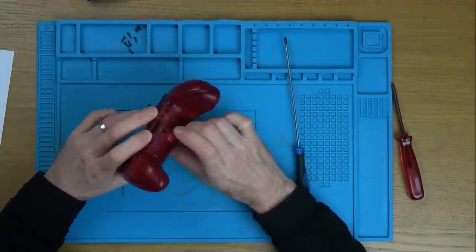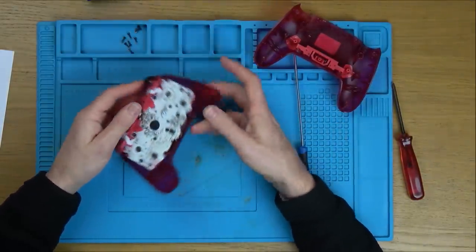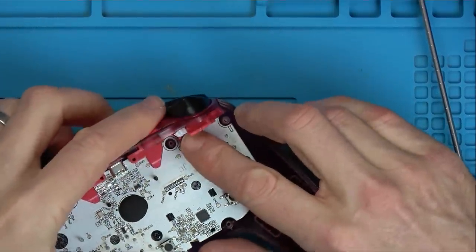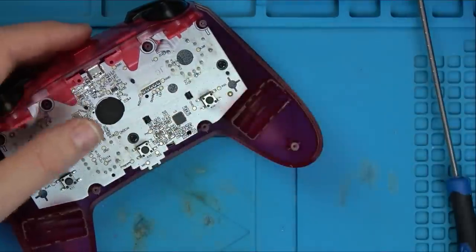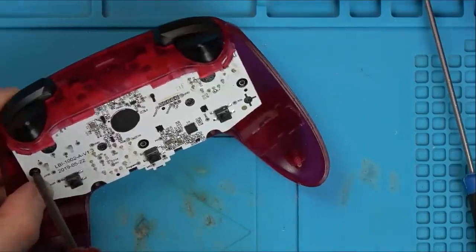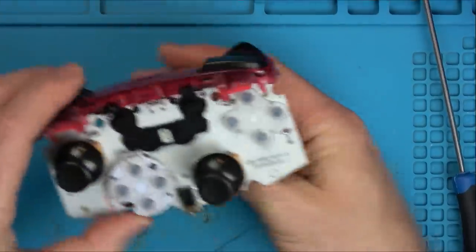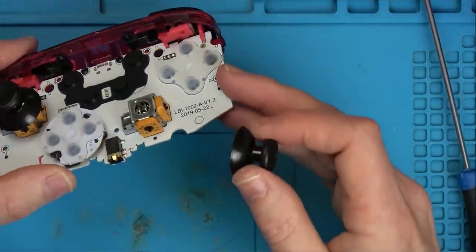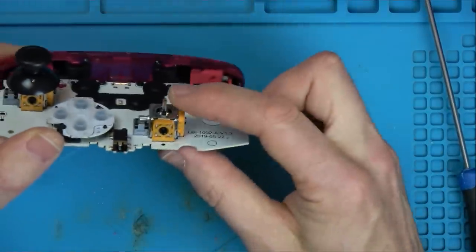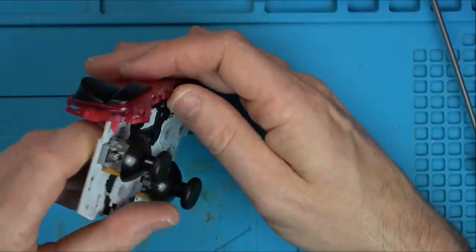It's got a headphone jack on the bottom of this one as well. So what we've got here - these buttons are not working and they're connected via a ribbon cable. Is the ribbon cable okay? It still seems to be attached on that side of the board. Hard to tell on this side because it's so crushed up. Let's undo this board and that will give us access to the solder joints on this cable. It all seems to be quite nicely made. You can see the cheaper analog sticks here versus the metal ones. These are the same ones in the fake Nintendo Switch Pro controllers, but these are not fake - these are licensed, just cheaper controllers. It unclips from here.